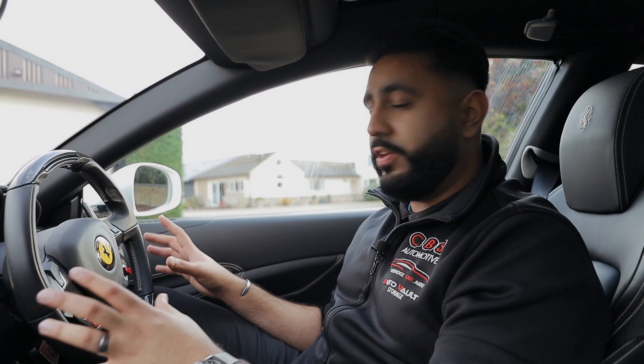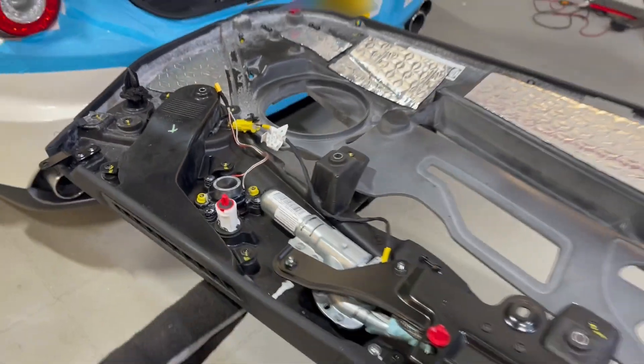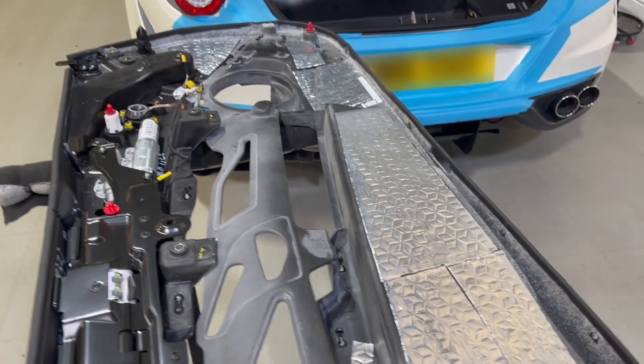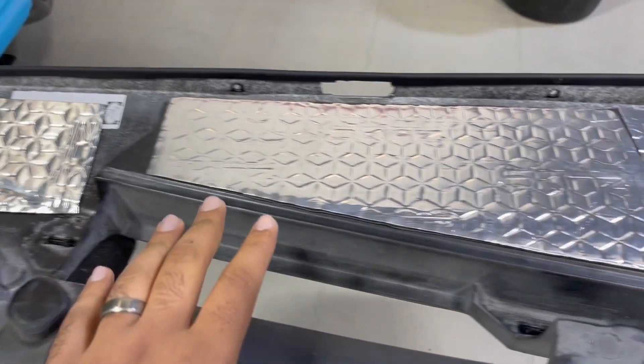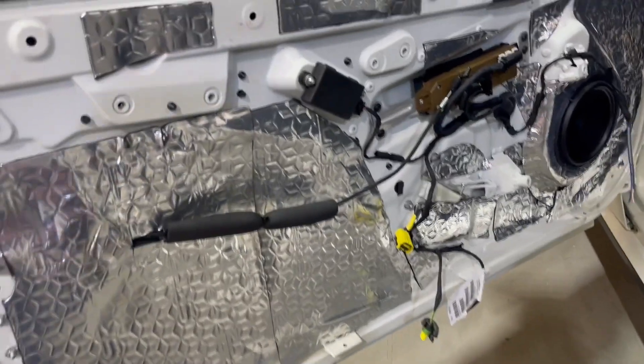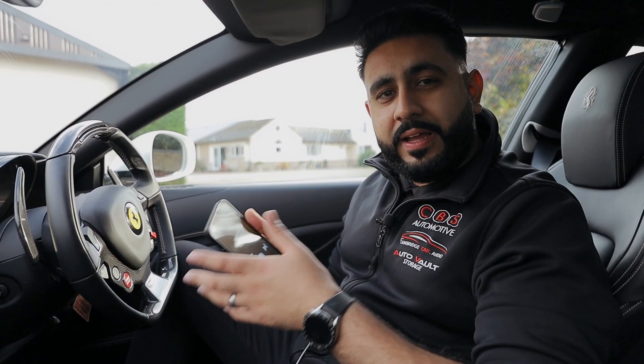On these FFs, having depth towards the front is a massive gain, so that really sounds nice. In terms of these doors, they're not built for sound — if we just changed the speakers themselves, this car would rattle like absolute crazy. We've got a lot more power going to them and those new mid basses are kicking a lot more, so the doors would shake to bits. So what we actually end up doing is soundproofing the vehicle, which reduces rattles and builds a better environment for the system to work in. These components are now being enhanced even further by the soundproofing work we've done inside the door.